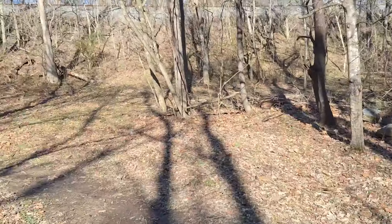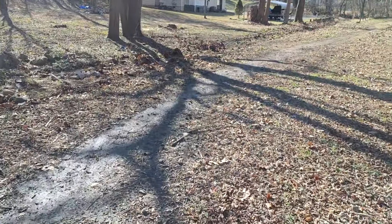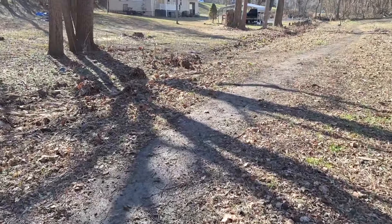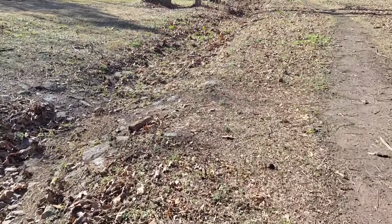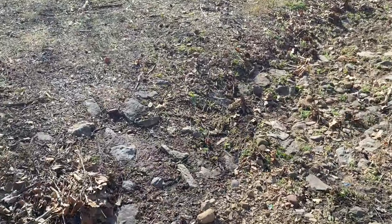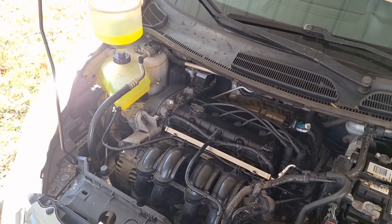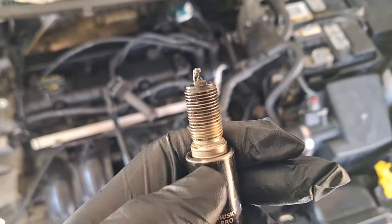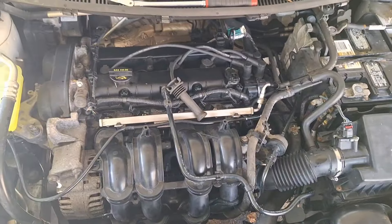Sometimes you just got to walk away. Did you see when I was cranking it over? It was putting combustion gases in the bottle — yep, good old combustion gases bubbles. This job absolutely mutilated my back this weekend, so this kind of stinks that it was all for nothing. Let me pull spark plug number two out — that was one of the two cylinders that were wet when I had the head off. Yeah, it's wet. I'm gonna crank the engine over to see if coolant spits out.